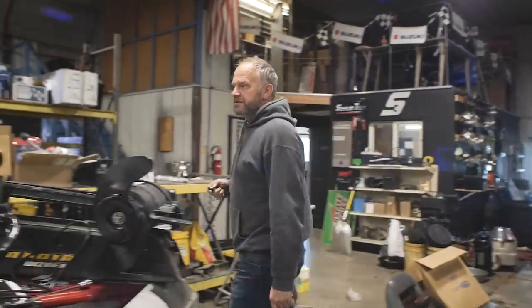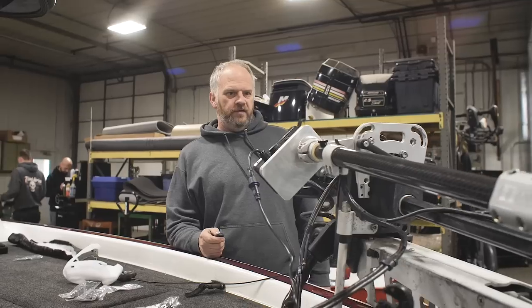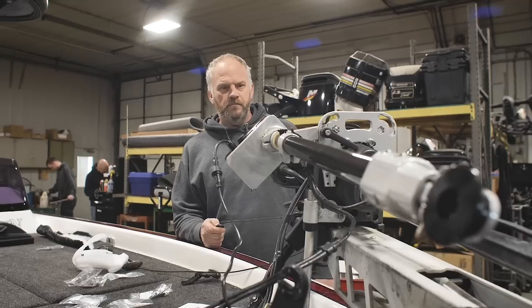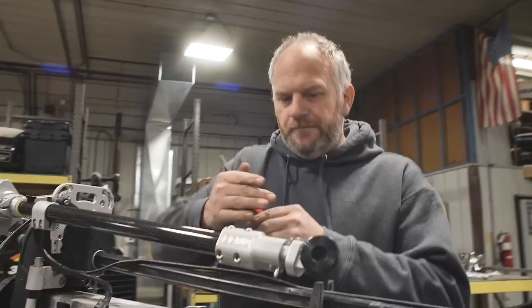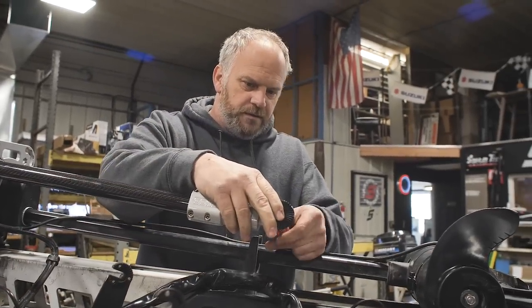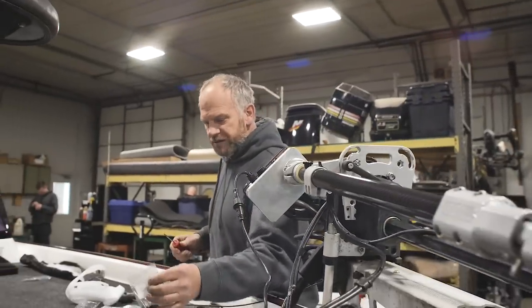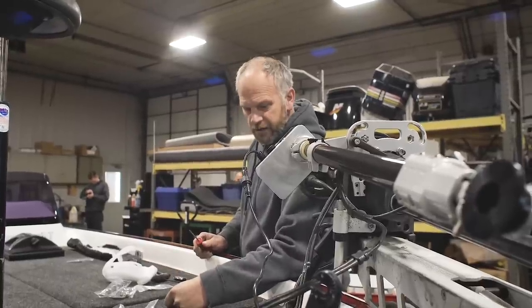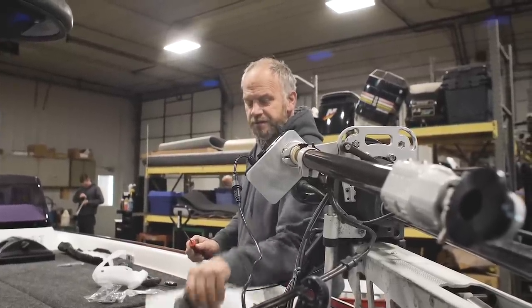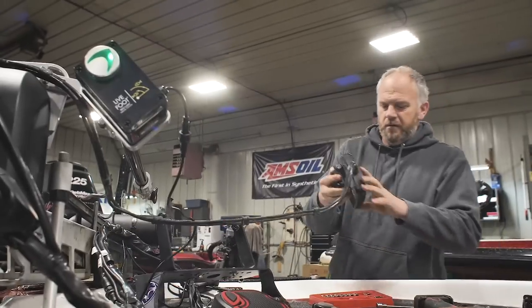We're setting up this bottom mount on here, but we have to make sure that A is square to B, so that we're not pointed away from the world. Okay, that'll be fine. And now I've already mocked this up here. This little piece right here gets screwed onto here. Super, super nice what Dave did here. Comes with every possible option. So this is a universal mount. This comes ready for Lowrance, Garmin, and Humminbird. And yeah, it is literally ready to go. So this is the step that we're on right here. Installing that bottom mount.